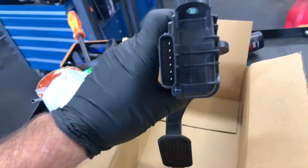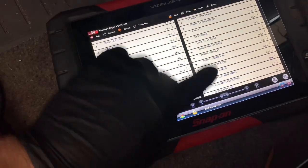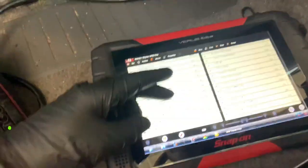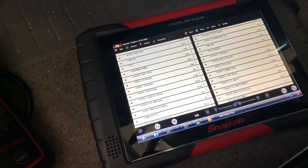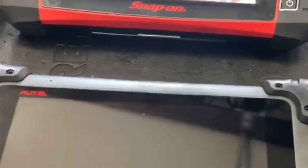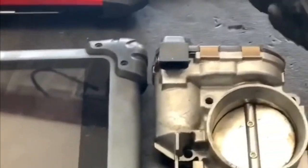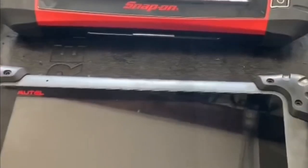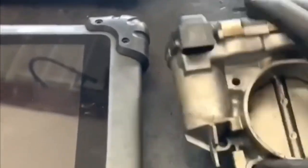In this video it's not a diagnostic video, but I thought I would share some diagnostic tips for you just in case you want to try to figure this out yourself. Most people are not going to have the tools to diagnose this — it requires a scan tool such as you see here, and some of the other tools would be a scan tool or a lab scope to check them out. My first tip is when you're checking out throttle bodies and accelerator pedals, clear the check engine light, because the scan tool will substitute values so the car can keep driving.